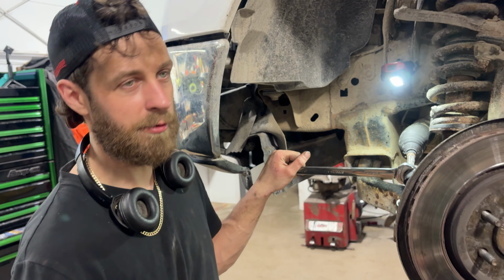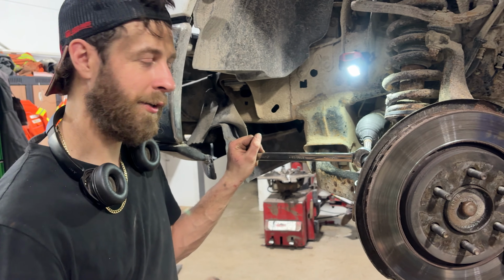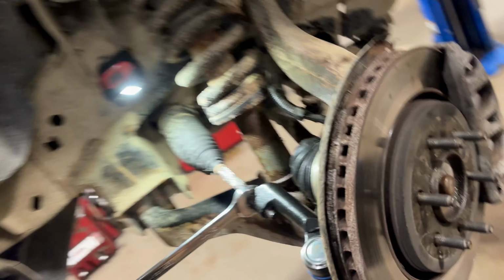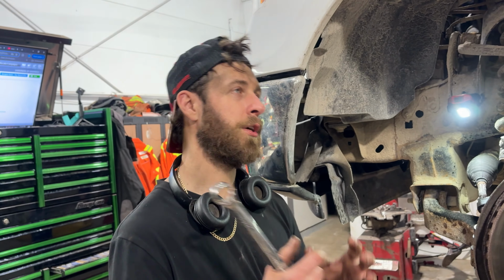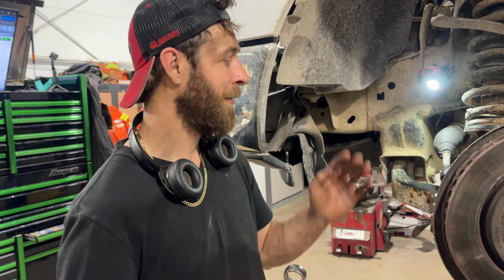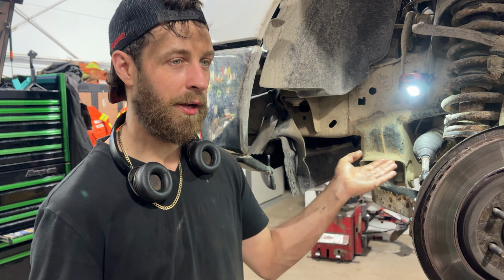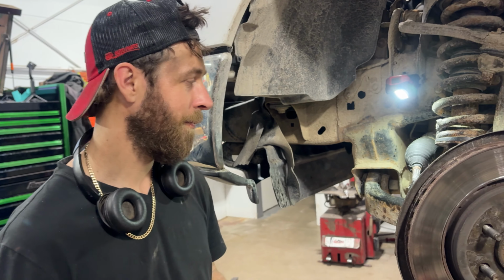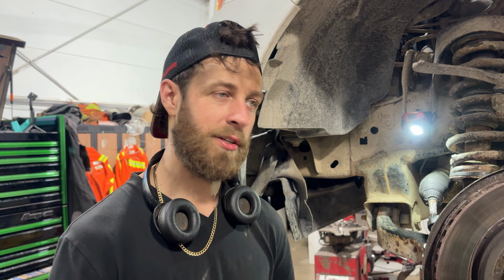So retorque your wheel nuts after 100 miles of driving, 100 kilometers of driving, and that's pretty much it. So hopefully, I know this video is gonna be long, but we got all the worst case scenarios for you to watch, and hopefully there's a solution in this video to help you change your tie rod ends. I really hope they're not as rusty as this. It's supposed to just be take this nut off, knock this out, loosen the jam nut, everything comes apart, you put it back together and torque it down, you're good to go. The book time's 54 minutes, and it took us 3 hours.